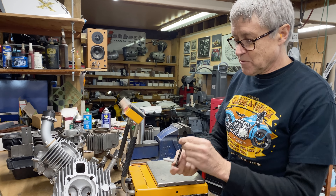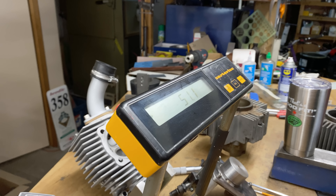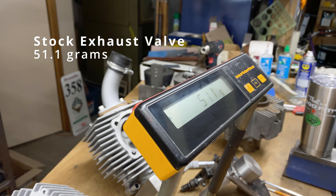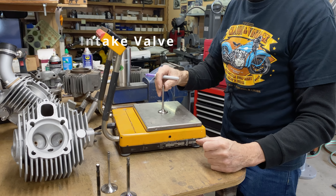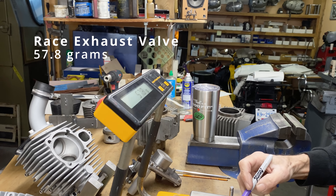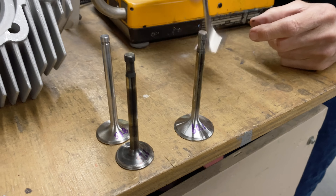This is what goes into making an Aermacchi race bike - raising the compression. Years ago when I was racing, I milled the head in between races and the next time I went out to the track the engine was definitely louder. Everybody noticed my exhaust note was louder and everybody noticed my bike was noticeably faster too. Raising the compression definitely helps when you want to go fast.